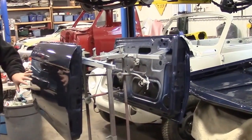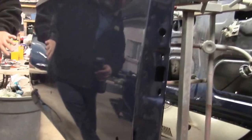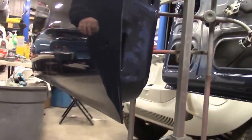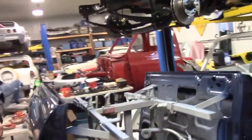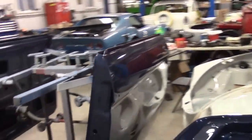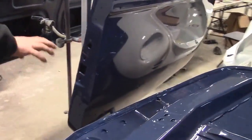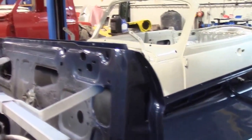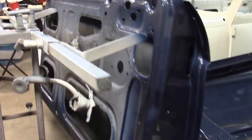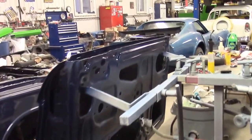The body work — I wouldn't want to say it's exceptional because it sounds cocky — but it's really, really straight. There was a considerable amount of damage and an unbelievable amount of body filler from previous repairs and scrubs. Now they've turned out quite nice. We have both doors done and the inside edges and everything. In the center section of the doors they will receive a rust treatment, and we're also going to put a sound deadener inside the door panels before the total reassembly and the door panels go on.